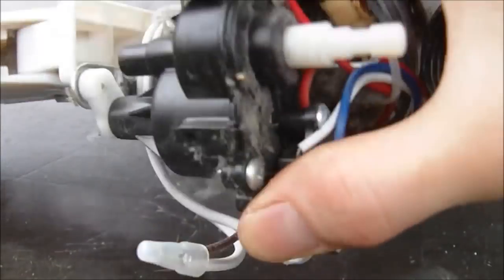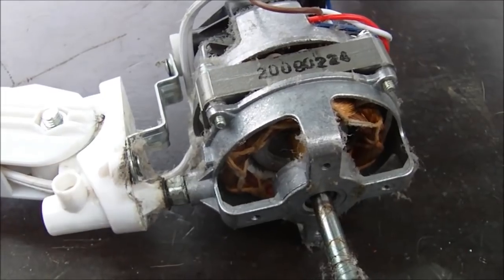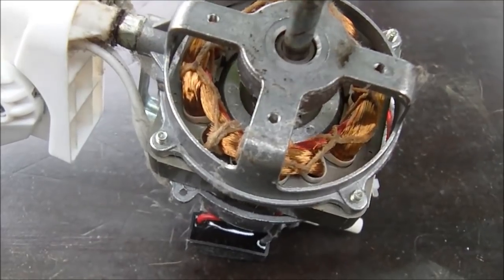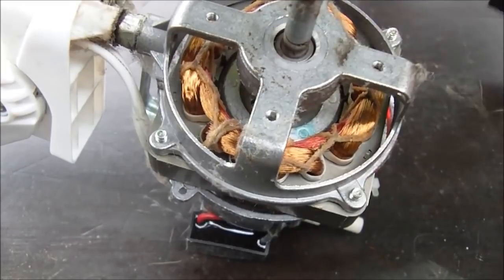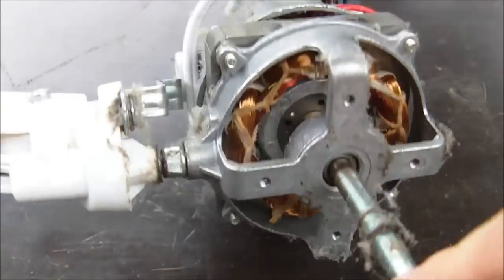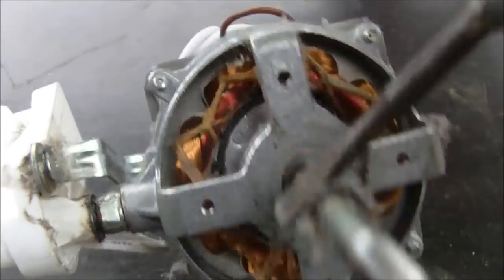You pull this out and it's free, and you push it in and it oscillates. So it will not turn on — it could be many things. We can take a look at the switch; the switch looks like it's in okay condition, all the wires are connected. So I have an idea what's wrong with this motor. A lot of these motors — what happens is the bearings just go dry and you have to oil them. Basically they stick, and the motor will not start up; it'll just sit there and be stuck.